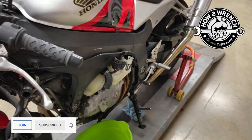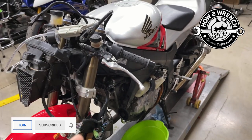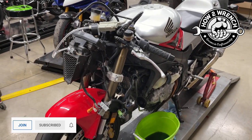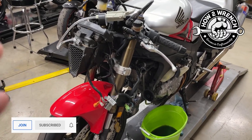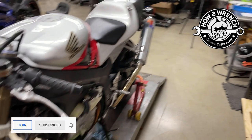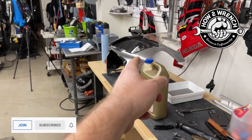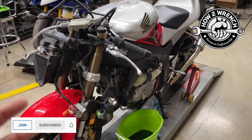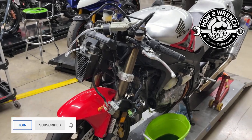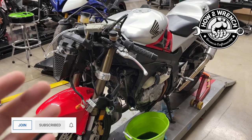We had an empty reservoir — I'll show how I cleaned it in the ultrasonic and vapor blaster, that thing was nasty but empty. The radiator was low but not empty, so fortunately the owner caught this at a good time and decided to park it and fix it. The motorcycle may seem significantly torn down, but that's just the way it needs to happen. You can perform the test with the lower fairings still on, but you do have to take the upper off, which is kind of backwards to most motorcycles. Follow the service manual so you don't waste time.